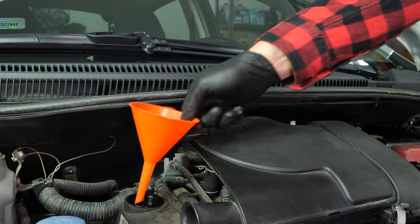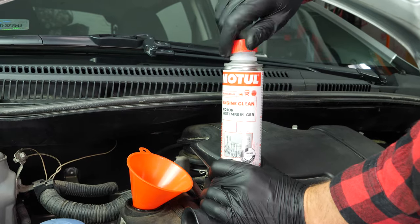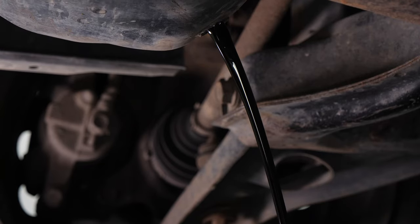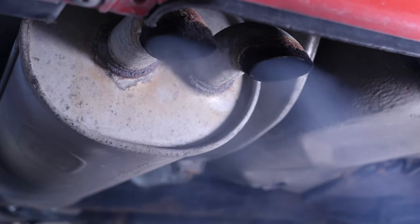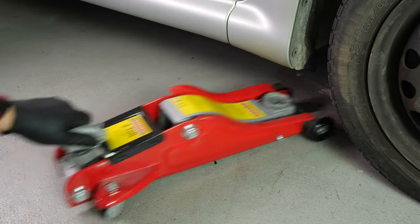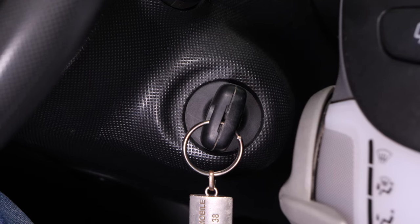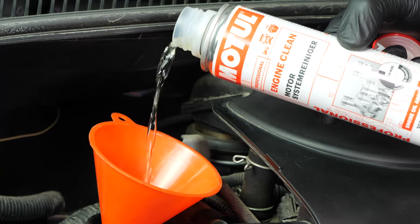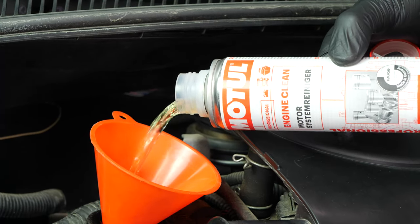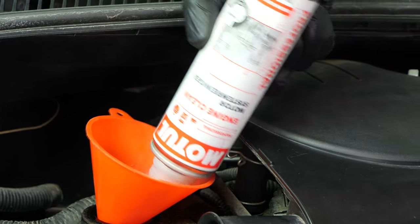Before changing the oil, we recommend adding a pre-oil change cleaner to the used oil. This will enable you to unclog your engine and get rid of any persistent residue, to reduce your consumption of oil and fuel and to reduce polluting emissions. Before using it, start your vehicle for 5 minutes so that the oil is slightly warm. Then add the product and leave your engine turning over slowly for 10–15 minutes. Once the product has been added, you must not drive your car. Ensure that you change the oil immediately afterwards.